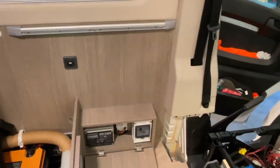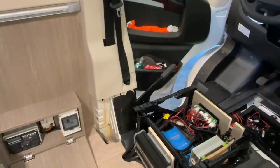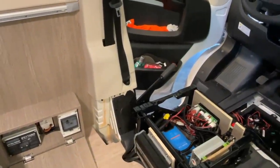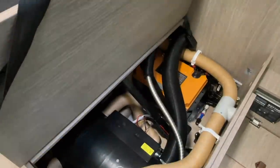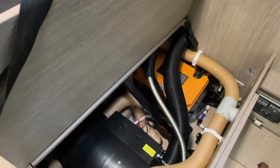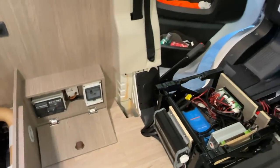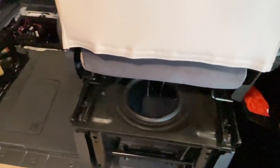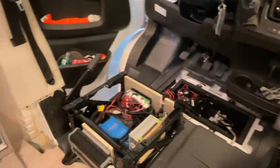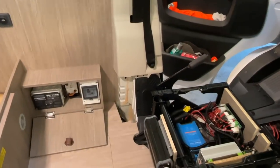And that's why it's simply very important to have something like this. We deliberately installed the inverter here behind the seat, because it fits well behind the trim and has good exhaust airflow - near the heater everything was too cramped. I don't want to force everything in there. So we have a 'tech seat' here with the inverter and charge booster, and the other seat is completely free - maybe for a diesel heater someday or nothing at all.